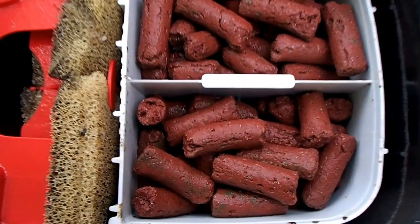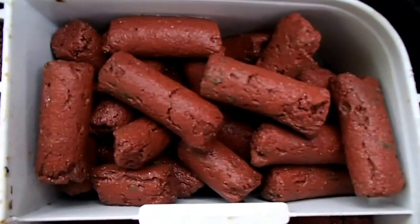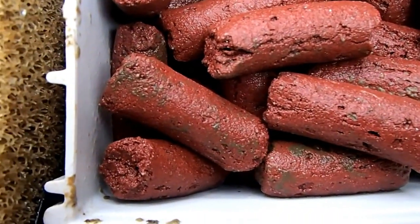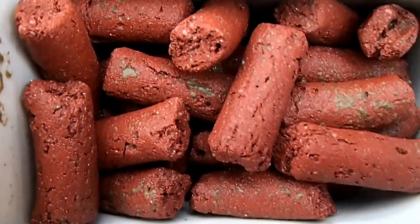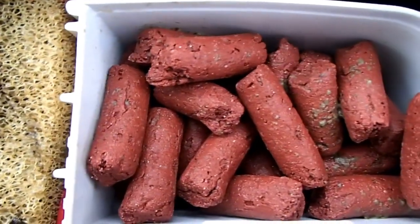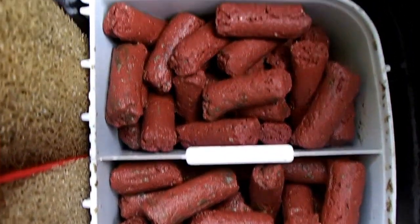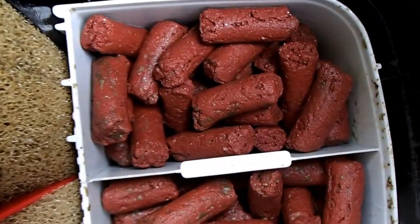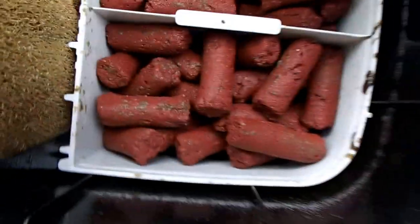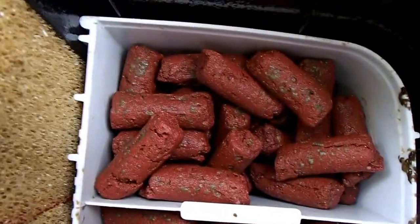We've pulled the lid off. We can see a little bit of dirt here — this is the filter with the three layers of foam. There's just a little bit of debris up here on the very top layer of the media. Looking at the one that had two layers of foam, it looks like there's more dirt — not exactly what I was hoping to see. Down at the second layer, I'm not sure there's an appreciable difference between the two, although the one with the three layers may be a bit less than this one. I think we still see the same trend — the results are pretty consistent.